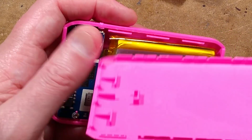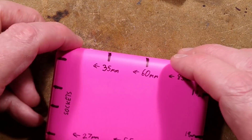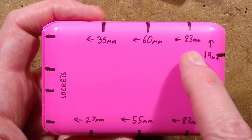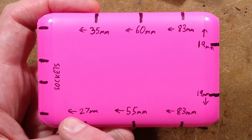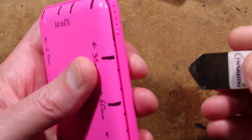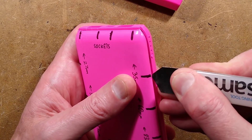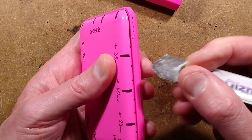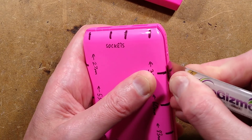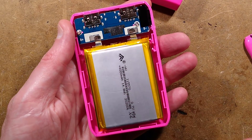The other clips are a little grip that does grip quite tightly - it's got a little tooth at the back of it. The measurements from the USB socket end with the text facing down are: 35mm, 60mm, 83mm, 90mm from each end, and then 27mm, 55mm, 83mm. To get this open you push the spudger - it hits a ledge first, then you push it a bit further and down, then you can lever it up. I recommend discharging the battery completely before you do that.